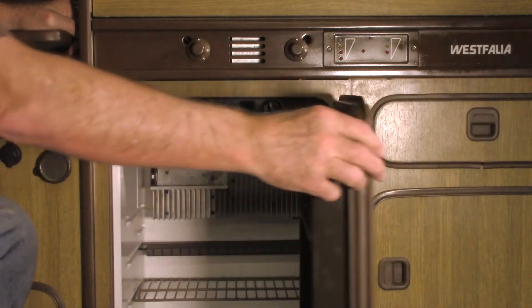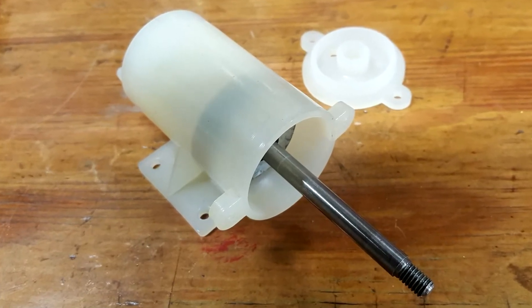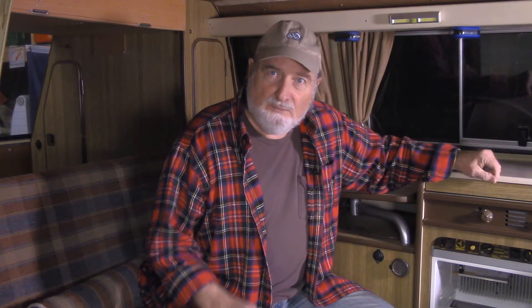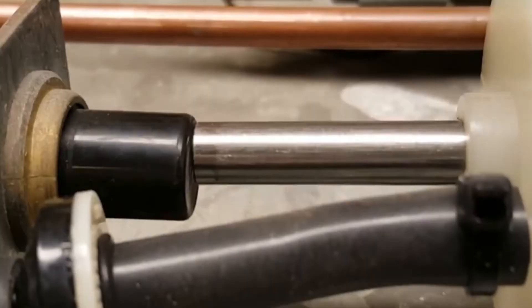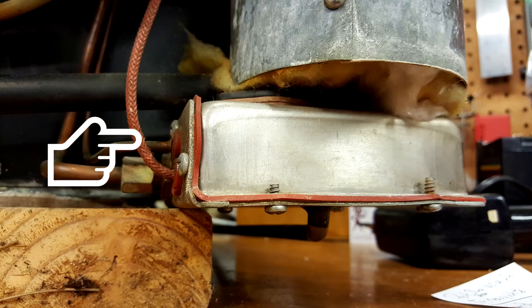It's not that hard, and there's plenty of write-ups and how-to videos online, so I won't go into that. But once the unit's on a workbench, I'll show you how to repair and modify the hand-operated pump. The air pump is located at the top left front of the unit. It's made of plastic, about the size of a large pill bottle. When the button is pushed in as far as it will go, the end of the shaft presses on a button which creates a spark in the small combustion chamber at the rear of the unit.